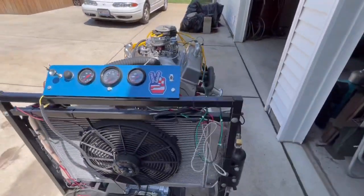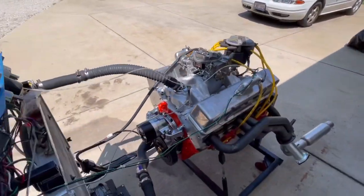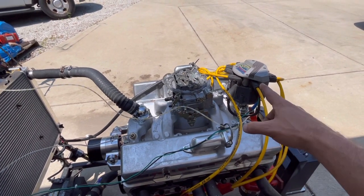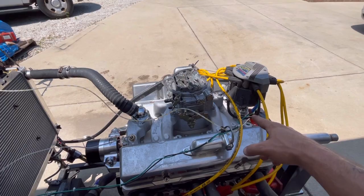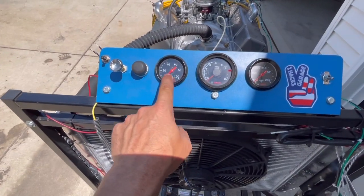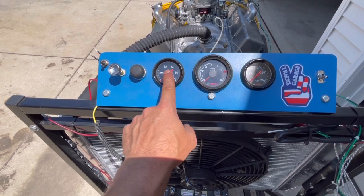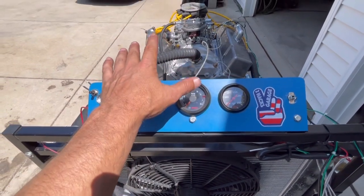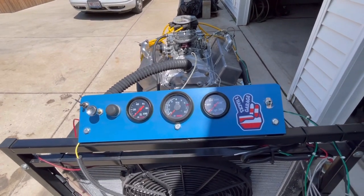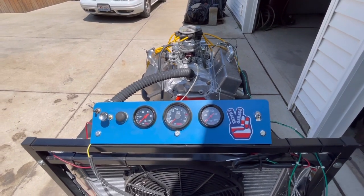Real quick — what you saw in a video before — I'm going to explain some tools. We do oil prime these engines before we fire them up. We have a tool you put down in the distributor hole that hooks up the oil pump. You crank it over and you want your oil PSI gauge. Not only can you see kind of where you're going to be at oil pressure, but also oil has been cycled through. So on the initial startup there is no metal-to-metal contact. Speaking of tools, let's go check those out.